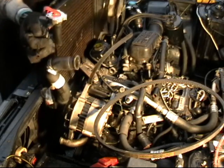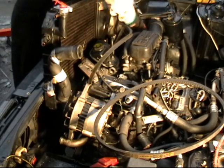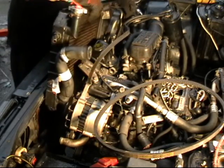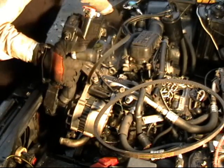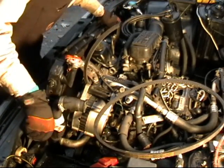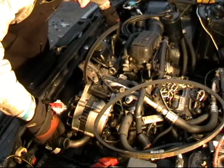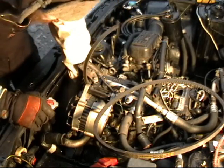Now we need to go in there — it's a little bit of a tight squeeze around this hose — but the side with the electric fan, if you drop that in first, that will be the way to go. You'll have more clearance if you remove the hose, but once again, if you're proficient with this, you'll know where to go. There we are. Now when you get your radiator down to the bottom, there are two locating holes, and there are rubber mounts on the bottom of the radiator itself that will fit into the core support at the bottom of the frame.